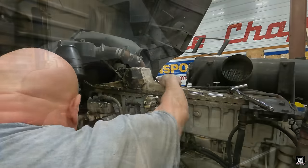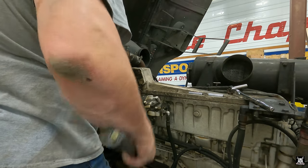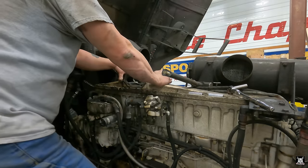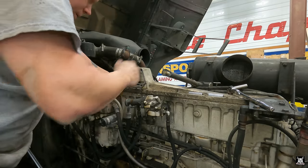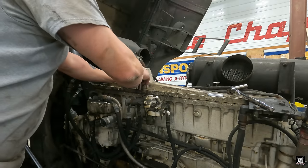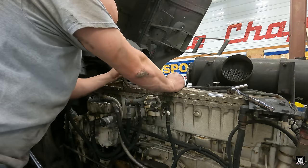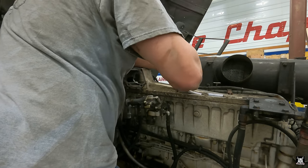Excellent, that's done. Now the reason I took that loose is because, see these bolts? You can't get them off with this bracket on. That comes off, just a gasket in there, it's all it is. I assume for a different engine it could have had twins, like a V12. If there was a 3412 built in this era, the air comes through, pressurizes both of them perhaps, I'm guessing. But you got to get these bolts out. And you can't get them bolts out with that plate on either side. So there's these two are regular headed bolts. And then these two, and then these two. Six in total. I think there should have been four, but it might have been the housing was damaged. So they put those style on the other side.